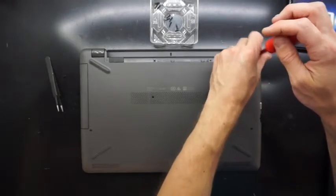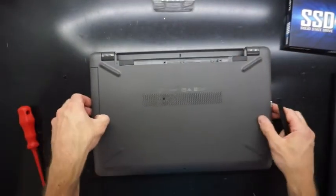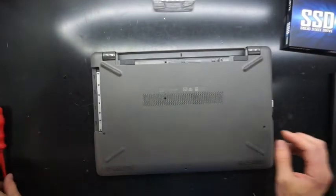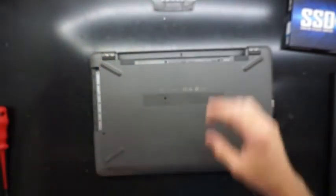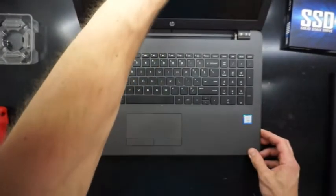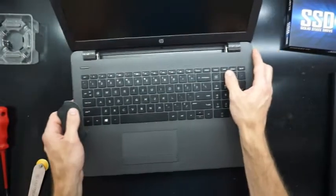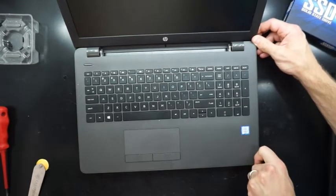Once you've finished removing the screws, next up we'll be taking out the DVD drive, which should be relatively easy with the screw removed for it. And then from there we'll be opening it up and flipping it over. You'd probably be required to use a soft plastic pry tool. Originally I went with my hard plastic pizza cutter, which I decided against. What I usually do is start from the side that the DVD drive was on, just because there are fewer ports you can potentially hit.